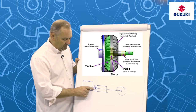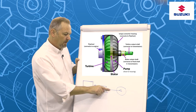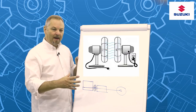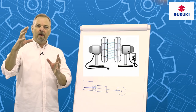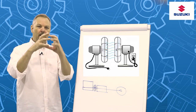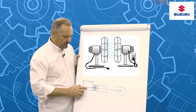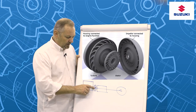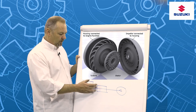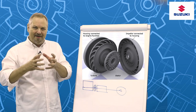That action starts to turn the turbine blades on the other side, which are connected to our output shaft in our gearbox and to our driven wheels. Imagine this as taking two standard fans and placing one in front of the other — switching on only one fan, whose airflow eventually causes the blades on the second fan to start turning. That's exactly the same principle as the torque converter. In the image, you'll see a part called a stator, which simply changes the direction of the hydraulic fluid flow so that one half of the torque converter doesn't work against the other half.